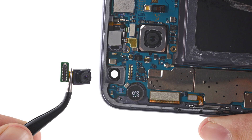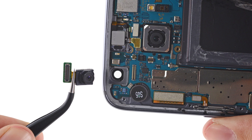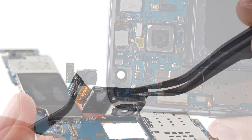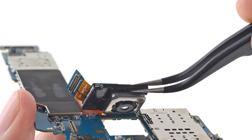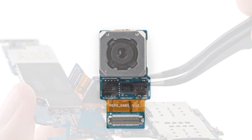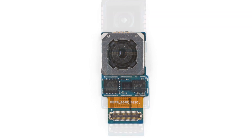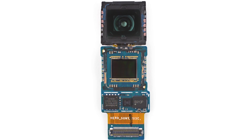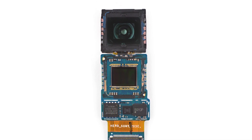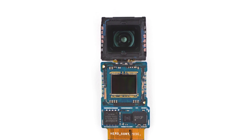On our way to get the motherboard out, we find the S7's 5 megapixel front-facing camera and the 12 megapixel rear-facing camera that is capable of recording 4K video. While the S7's rear-facing camera may have lost some megapixels from the S6, which had 16 megapixels, the S7's camera has 25% larger pixels, which will improve overall image quality. It also has dual pixel autofocus technology, also known as phase detection, for every pixel. So despite having fewer pixels, even photos taken in the worst lighting should come out crystal clear.